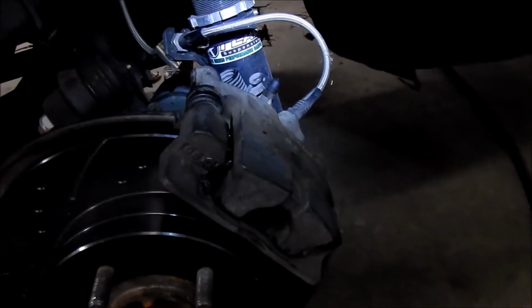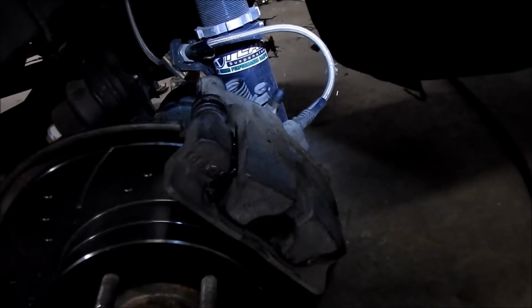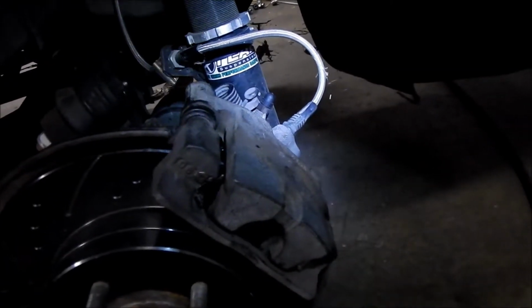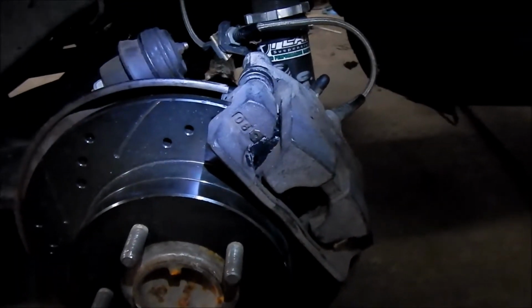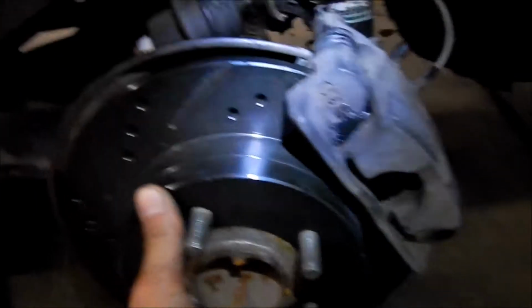The parts for the rear brake are much smaller than the front. It's 14s and 12 millimeters. So I didn't tighten them down too tight. I didn't want to break them. I'm pretty sure you can probably snap that one pretty easy. The caliper bolt here. So this side is good. There's no holes in the boots or anything. I was kind of alarmed when I saw that the pads were sticking over the rotor, but that's because the rotor wasn't seated fully.